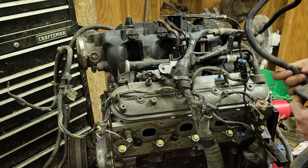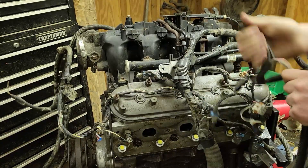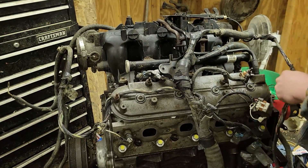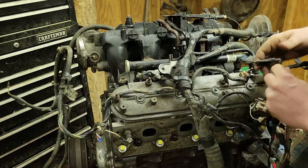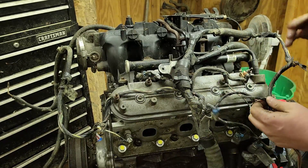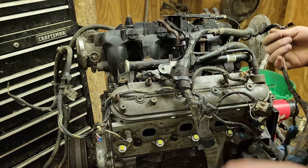We're not getting fancy with any of this. It's not like we're trying to go to SEMA - I just want this thing to roll down the road reliably. This loom just pulls straight off, no tricks of the trade. What I want you to focus on when you're doing your wiring harness: this is a bunch of spaghetti, a whole bunch of crap, but none of that matters. The only thing that matters is the two wires you are currently working with - two wires and a plug. If you know exactly where these wires go and you have them labeled, you can just cut this, take all your loom and tape off, and pull it straight through.